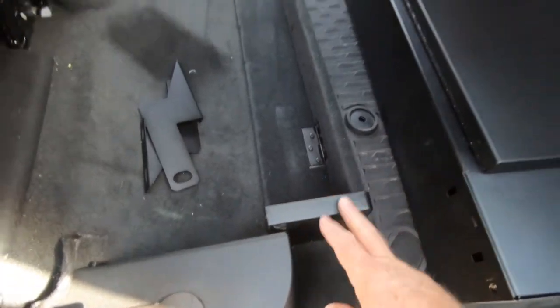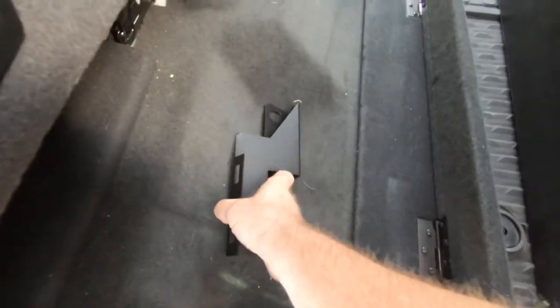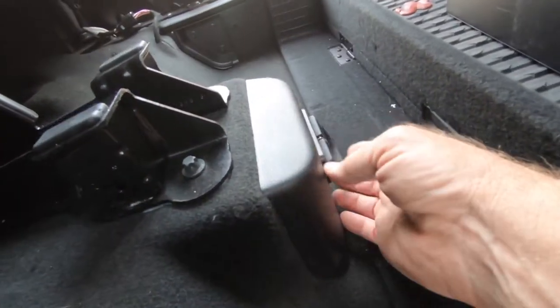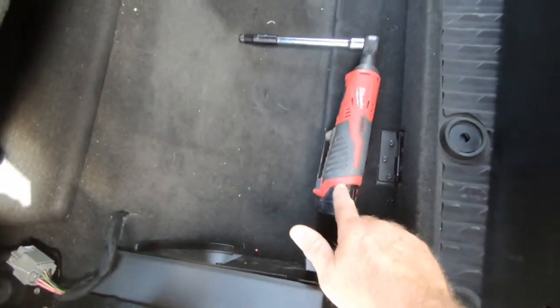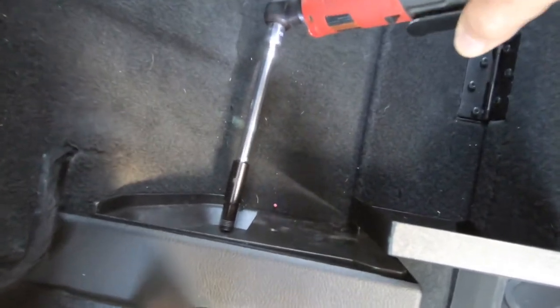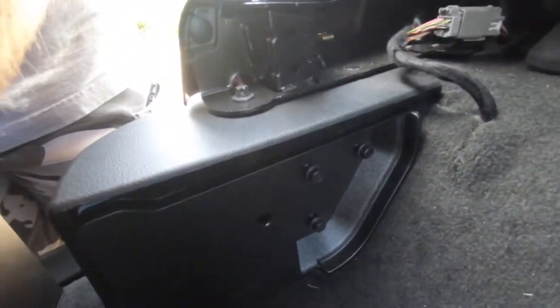The size of this box is going to require the barrier to come out. There's a little section in the directions that tells you how to take that out. We're going to take the brackets out of the way. We're going to start by taking this plate off — this is the mechanism that holds that barrier. To remove those three bolts, I'm taking my Milwaukee 3/8-drive ratchet with an extension and a 10-millimeter socket and removing these bolts. Once that divider unit's out, you'll replace those plastic covers on the inside. Then we'll move on to step three — removing the centerpiece right here.